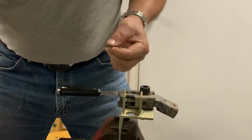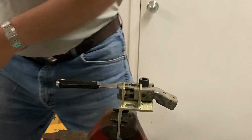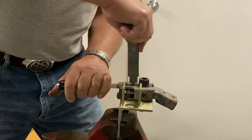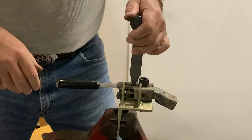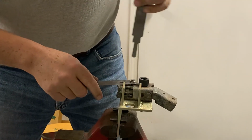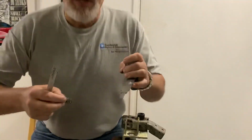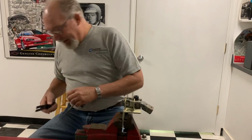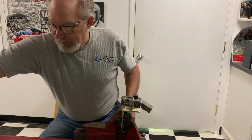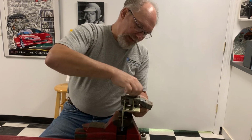And you can take out the retaining washer that retains the plunger. And that all gets cleaned up. Now, the spring that's under there is a pretty strong spring. So you want to put your tool back in. And when you pull it out, you don't want the spring coming flying up and hitting you in the face. Ask me how I know about the spring coming at you. So now you pretty much got everything ripped apart.